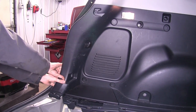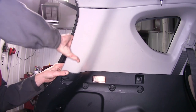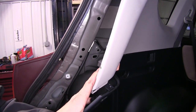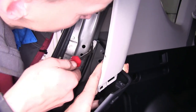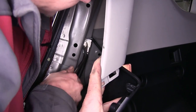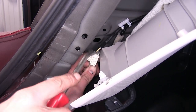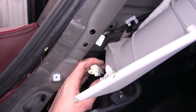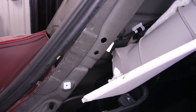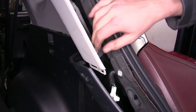Those are the two bolts that are still in there. Now pull back our white panel a bit as well. Right here we'll find our connector for our driver's side tail light assembly. Take our trim panel tool, pop it off, push on the tab here, and disconnect it. Separate those two. We'll leave those disconnected and repeat the same process for the passenger side panel in order to get access to our connector. With our passenger side disconnected, we can now start making our connections.